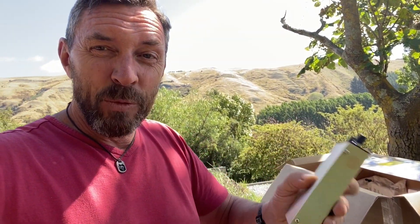With the intercom, Dynon only make a two-place panel-mounted intercom, and that was a problem for me because I've got a four-place aircraft. They sold me this PS Engineering PM3000 — a four-place intercom that is panel-mounted. Whilst it's not huge, it comes without a separate radio head, so the whole thing has to be mounted on the panel. Bearing in mind my panel is hinged, I've got a bit of a problem I don't know how to resolve yet. It would have been nicer if the head was panel-mounted and the guts went in the avionics rack. I think it needs some sort of retaining bracket at the back given turbulence concerns.